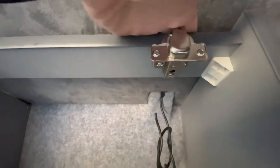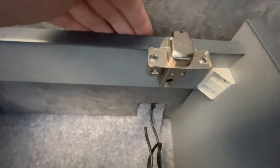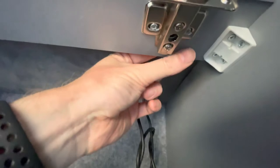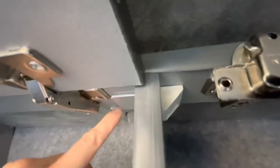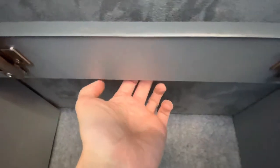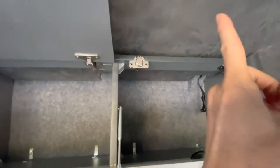Where these other ribs are, I'm going to put a little packer in there because there's about a 15mm gap due to the roof lining. I'll put a packer at the back, go through there with a washer and into that rib, then do the same at each rib along — packer at the back, up through with a washer into that rib. So you've then got one, two, three vertical securing points, plus one across that back bit, and six more — two in each locker right across.